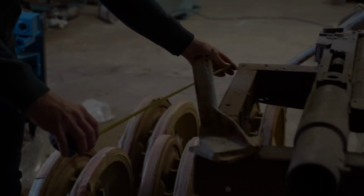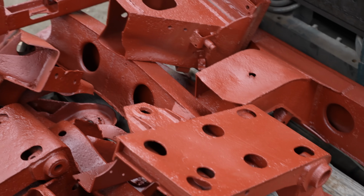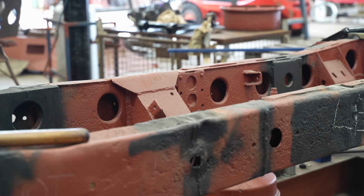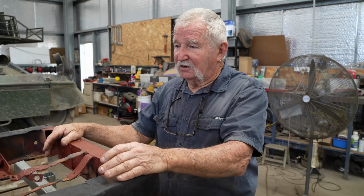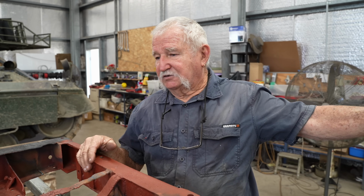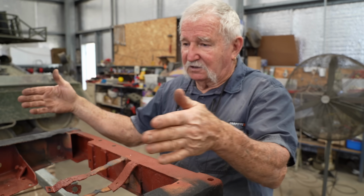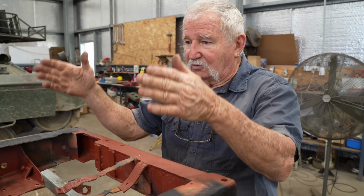When we got back to Australia, Bo transcribed his drawings into CAD and passed the chassis measurements onto Al, which he used to meticulously rebuild the chassis. I've had to build a jig to sit it on to get it as straight as we can. I started on the bench first with the rear end, put it up onto the jig. We had uprights on it to keep it all the right measurement all the way through.